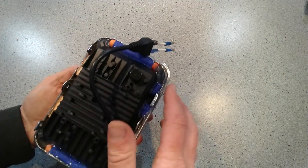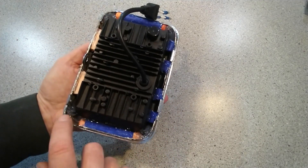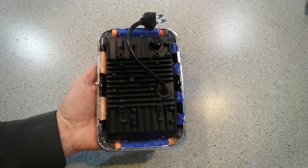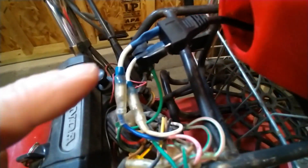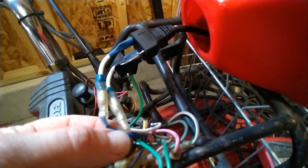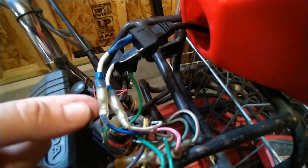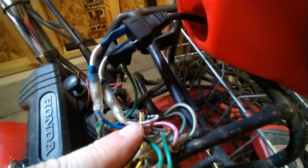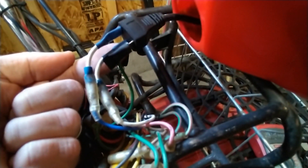This is a quick way of doing that — I'll put some links in the description for the right components. The silicone is now dry and I can get this in the machine. You can see my green ground wire going to the ground pin on the connector, my blue Honda wire going to the high beam connector on the headlamp, and my white Honda wire going to the low beam connector on the headlight.